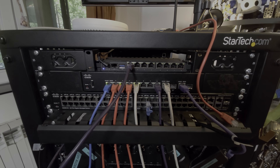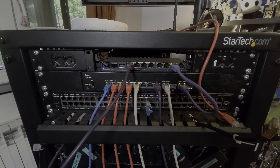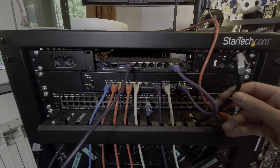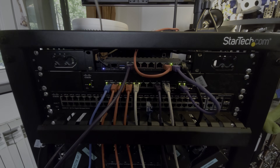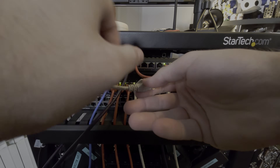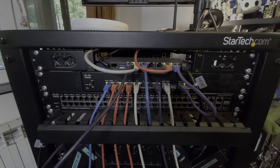The plan was to use the 10-port Cisco switch that I already had as a dumb switch for my management network — this is where I have all the admin interfaces for things like Proxmox, TrueNAS, MikroTik, and so on. All of the onboard NICs from my other servers are already plugged into this one, so all that's missing is the uplink to my firewall. We'll configure this later to be part of a different network, and besides that I'll need to plug in a few devices to my LAN network as well. Since I'm not using the big Cisco switch anymore I'll use the ports on the router as a temporary solution. So here we have my desktop in the last port, my Home Assistant box in the next one, my access point, and finally my NAS — since my NAS has a NIC in each network that needs storage, I'm not routing any storage traffic.